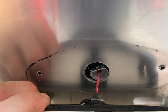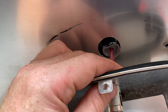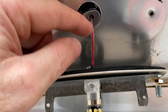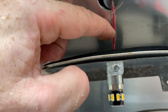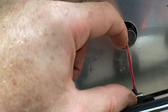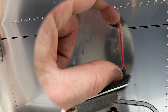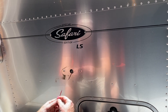Right there — we can see the plate and that one positive wire coming in. It has just a little bit of traction so I can pull it out to get a little distance without pulling too aggressively. I've got maybe two inches, which should give me enough to crimp a couple of wire connectors on there and then heat them up with the heat gun to shrink-wrap them for a nice, solid connection. I've made two exposed wire ends and we're going to crimp those together and then heat shrink them.